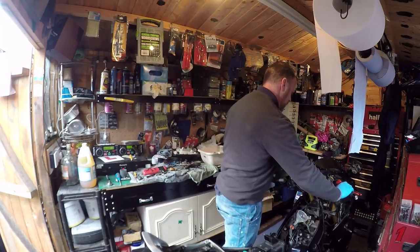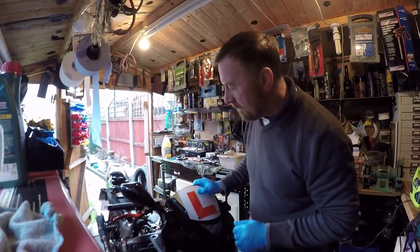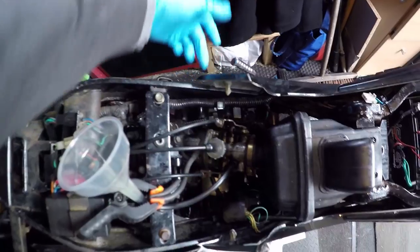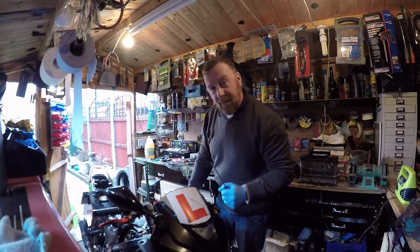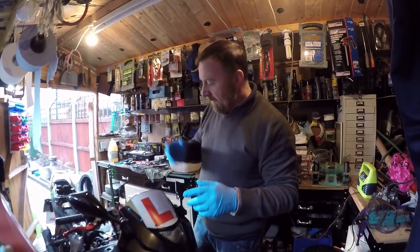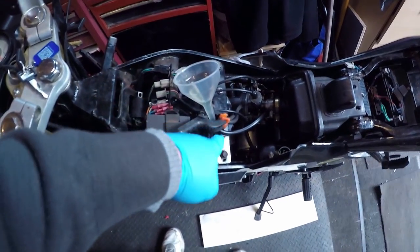So it's a case of starting it. Now I've got to let it run and let the revs drop — and that's reasonably happy. There is the idle adjustment. You have to pull this panel out and squeeze the screwdriver in, try to get it through this little bit here, and try to tighten and loosen it. The whole design for basic maintenance is not brilliant — not easy to get to. Remember to keep the petrol topped up in the funnel; if it ran low, the pipe would suck in air and the revs would go right up. So you need to block off the air pipe and make sure you rig up a little test pipe. It's a bottle, but I think this works quite well — there's no leaking here.